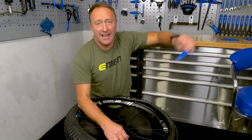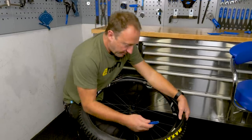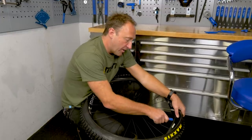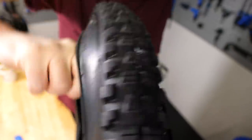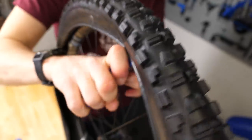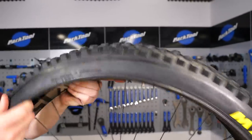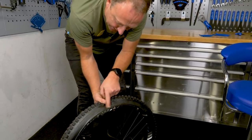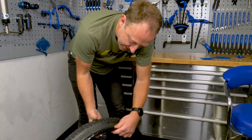I can actually use a metal lever in this situation — it's definitely a preference of mine. I'm starting on the left-hand side. Be careful not to scratch the rim on your bike. Leave that over, and then bit by bit, 25mm at a time, on she goes. Finish it off with your hands. What we're trying to do now is get that bead — and when I say bead, I mean the outside edge of the tire which has a wire insert in there — get that in all the way.